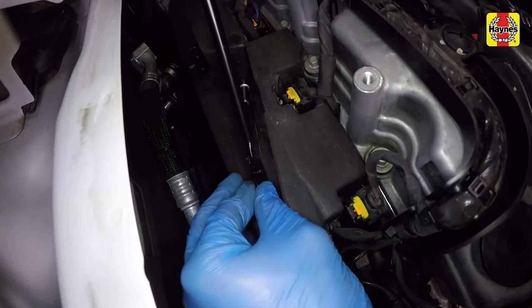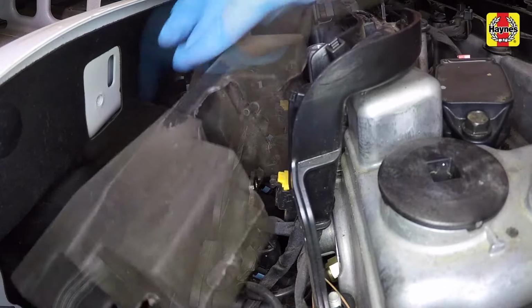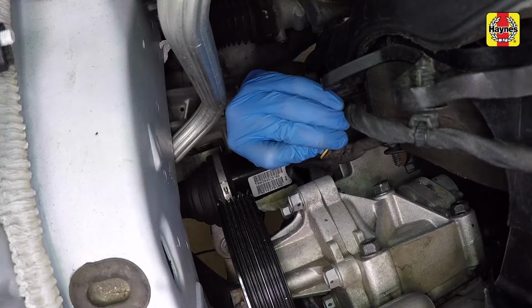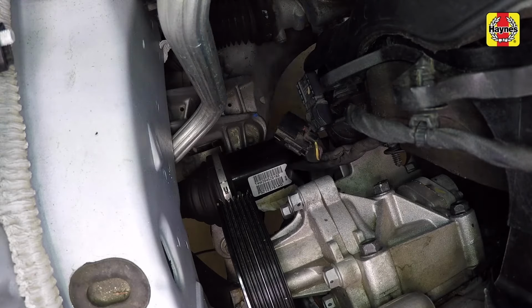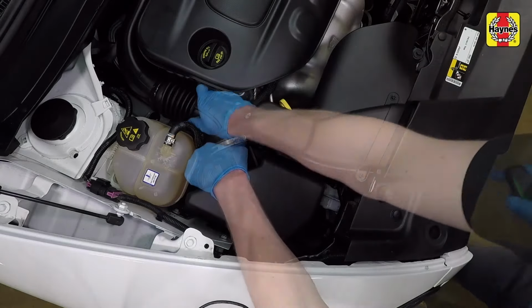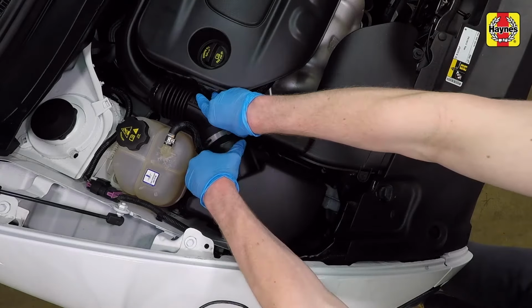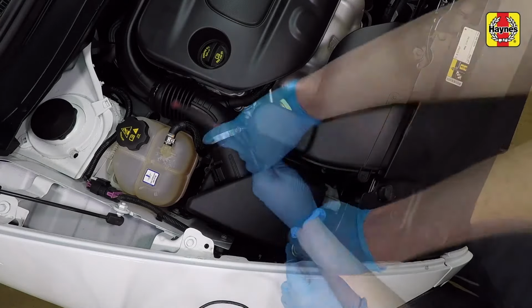Using a screwdriver, separate the injector sound insulator and carefully remove the insulator. Disconnect the electrical connector to the manifold pressure MAP sensor. Loosen the air filter housing fresh air duct clamp, then separate the duct from the top cover. Loosen the filter housing top cover mounting screws.